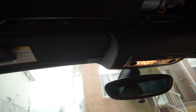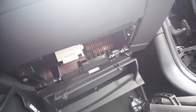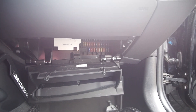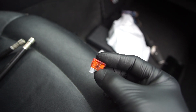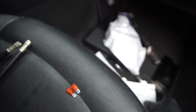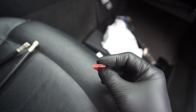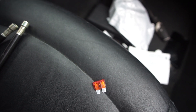I think the fuse is blowing again - something is really not working properly. Here's the fuse panel - if you ever wonder where the fuse panel is on the BMW Z4, it's right behind the glove box. Here's our blown fuse, you can see there's a little black dot in there. The fuses that power the soft top are fuse sockets number 12, 31, and 55. This is the 31 - it's likely controlling the switch at the center console. We're gonna replace it.